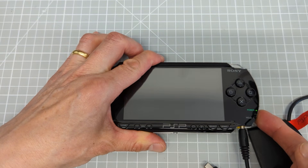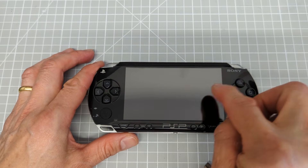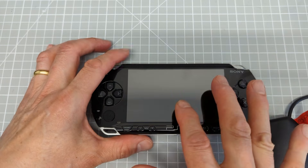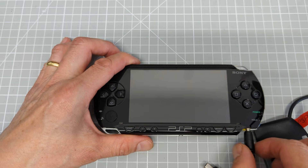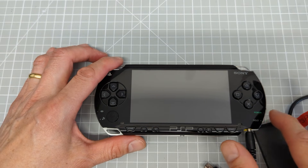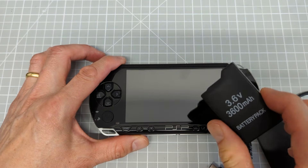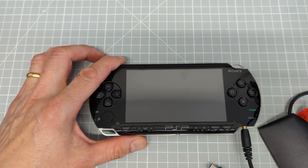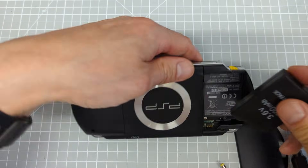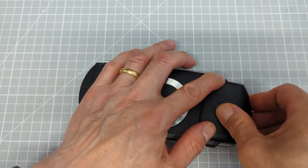But you should be able to hold it on and get a green light coming on, and that signifies that the power supply is working and power is getting into the circuit. Sometimes the PlayStation will be able to turn on at that point. But that just signifies that you are getting power coming in through your cable and into the circuit board itself. The chances are then that it is your battery which you have a problem with, so just make sure you replace that. This is just a generic replacement battery that I have here — let me just pop that back in.